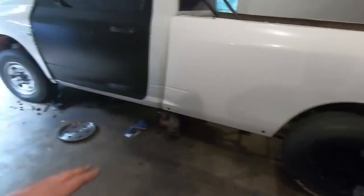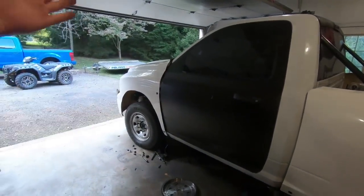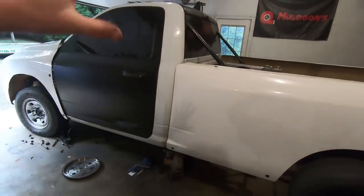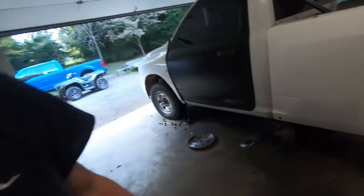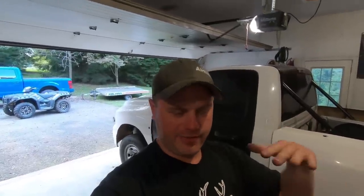So what we're going to do is put our mock-up 48RE back in along with our transmission crossmember and bolt all that stuff up. That way our front clip will get back where it's supposed to be and come down — everything will be in the location it's in when the truck is fully together and ready to run. Then we're going to try to keep that hood stack from moving. I'm leaning toward one approach, but I'm not sure if we have enough meat there. We'll get this whole engine sorted out to where it should be, and then we'll talk about that.